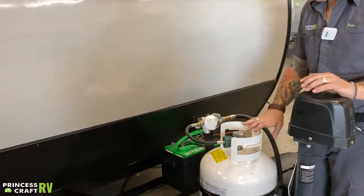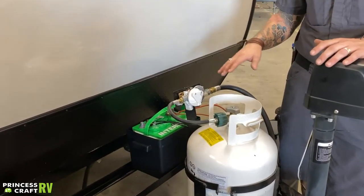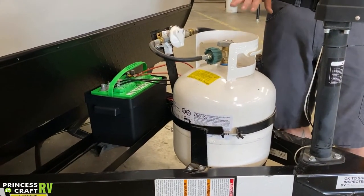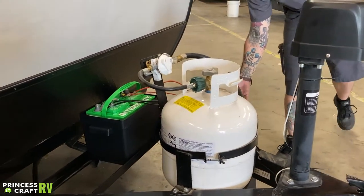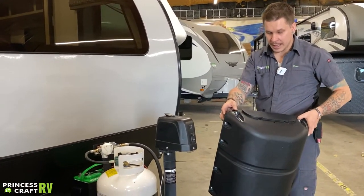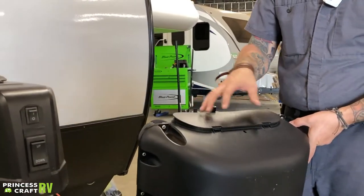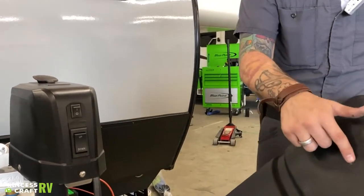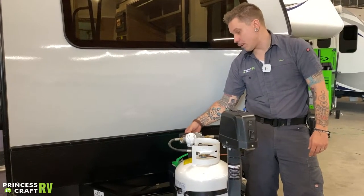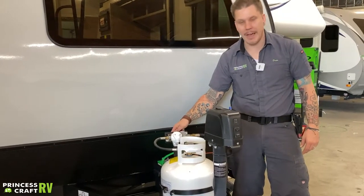Beside that, we have your propane tank — a 20-pound propane cylinder with an open and close valve on top. It's held in place with a tension band and wing nut, and completely covered with the propane container cover when going down the road. Orientation of this container should have the door facing away from the direction of travel so the wind doesn't catch the door and open it. There's a hole on the back and a stud so the container sits in place — lock the wing nut down to keep it from blowing off.